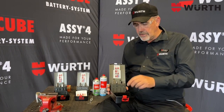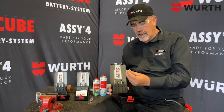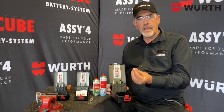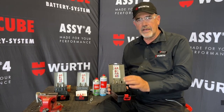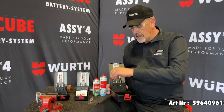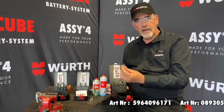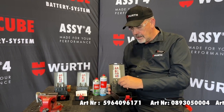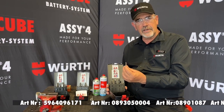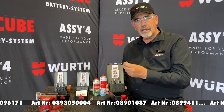The inserts are made of steel and have a one millimeter wall thickness. Each Timesert kit comes with a drill, a seat cutter or collar cutter, a tap specifically designed for the Timesert outside thread, and then your inserting tool.